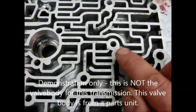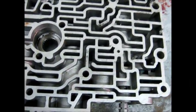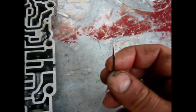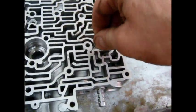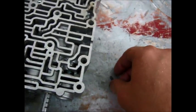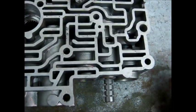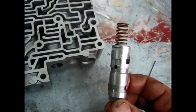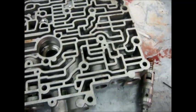I'm going to show you how to get out a blind roll pin. If there's a hole drilled all the way through from the back, you can punch it out. But this one has no hole from the other side, so the only way to get it out is to extract it. I've got this little piece of hard flat steel stock ground down to a point — this actually came with the shift kit for this purpose. Simply stick it down into the roll pin and turn it; you'll feel it grab. The trick is to turn it in the direction that tightens the roll pin up on itself — a roll pin is actually a spiral of thin sheet metal. Pull it out that way using this little homemade tool. The roll pin would go in that groove and lock the bushing in there. That's how you get those roll pins out when you don't have a hole from the back to use a punch.